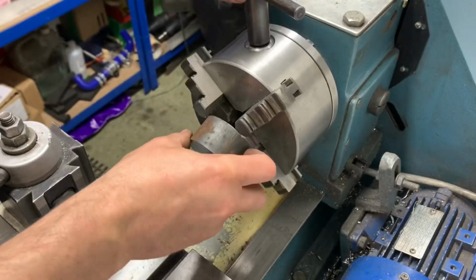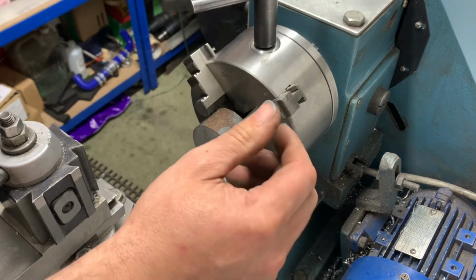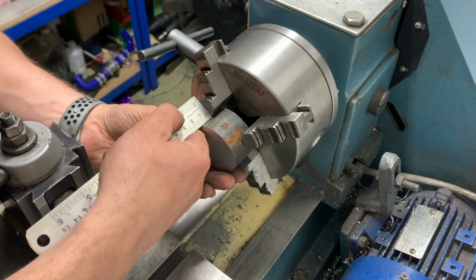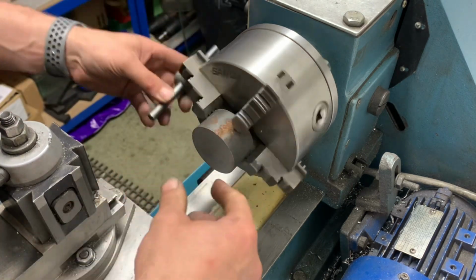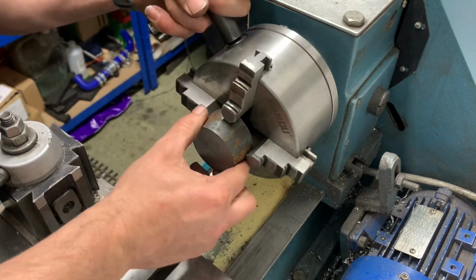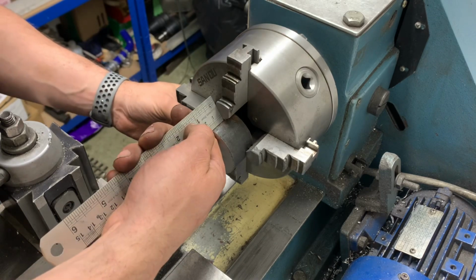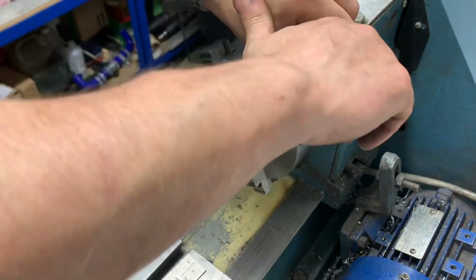Well, 4 of them, the hole's going to be off centre. So I'm going to chuck a couple in the lathe and you can watch me do it, okay? This is pretty simple. I'm not going to clean up the outside because it's all going to get machined off anyway. I'm just going to pop it in. I'm going to make sure I've got 15mm sticking out minimum, because I guess 16mm, and then that can give me a little bit to come off. And we're holding it, we've got 3 teeth on there. Yep. So that means we can stop just before my jaws. We'll crank that up.